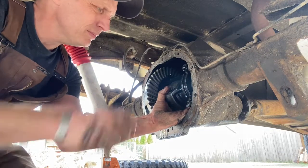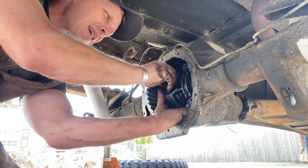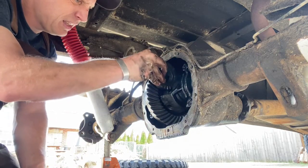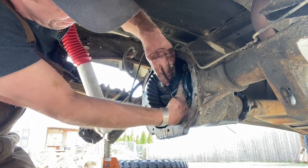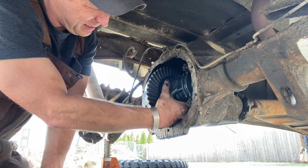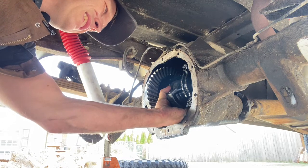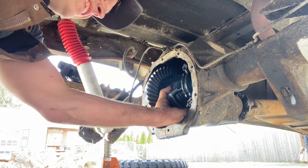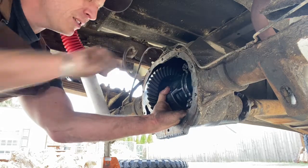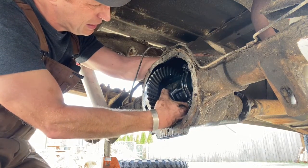Come on now. Dropped it in the middle again. Turn it to the C-clip slot, which is there, and I need to get a good look at this axle while I'm doing this. That C-clip goes right there. Dropped right in that time! Pull that axle back out — C-clip is in.